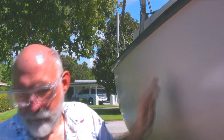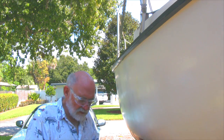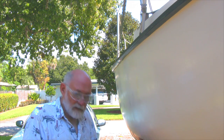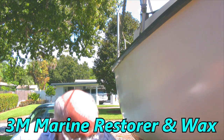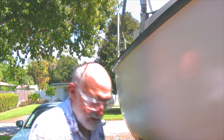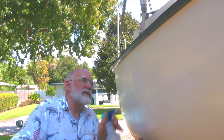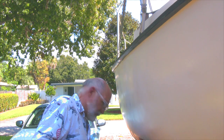When they have a heavily oxidized surface, all kinds of junk grows on it — you get a green or even black looking boat and it's really hard to clean. So if I have a wax coat on it, I don't think the film will even form, and if it does, it'll be a lot easier to clean. I've got some splotchy areas right here, so I'm going to put a little bit of this 3M Restore on — not very much, just a small space. Put a little water on there and we'll see how that works.